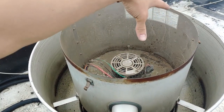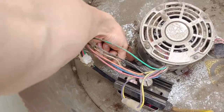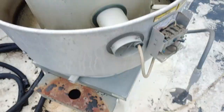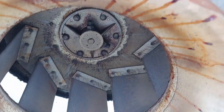We'll be ordering a new motor. I'm going to make sure I can get the shaft free of the blower wheel. If I can't, we'll order what's called a power pack — basically the whole center core gets replaced and you don't have to worry about getting the old motor off. I think all we have to do is unplug it, take these four little mounting nuts off — three of them are already off — tip this thing up, and loosen those two set screws to pull it off.